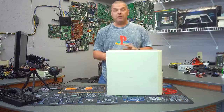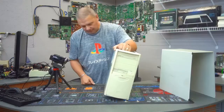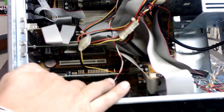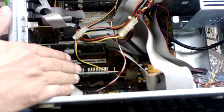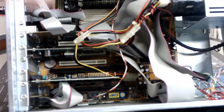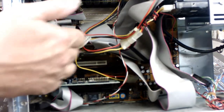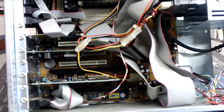I thought, well, we must be dealing with some kind of unique motherboard. Let me pop this open and take a look. A couple of things I noticed that were very awkward: we've got the onboard audio going down to the motherboard, an add-on Crystal sound card, what looks like three ISA slots and four PCI slots. The add-on card we saw on the back with the two USBs and PS/2 is actually plugged into the controller on the motherboard, and the VGA is also going down to the motherboard.